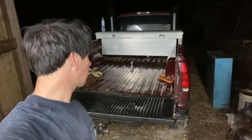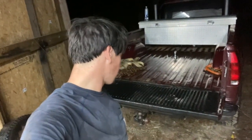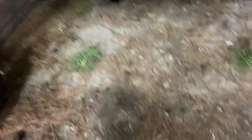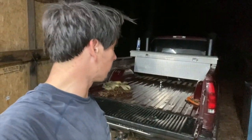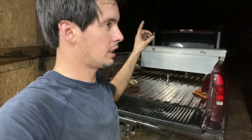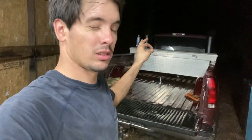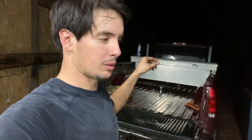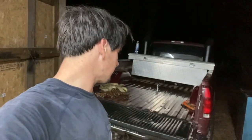That's finally all the parts we had for this truck — finally got it all finished up. I am going to take it to a local hitch shop and have them wire a brake controller and a new plug, since the one I've got is not doing so well. That's gonna be it for this truck for now, unless something goes wrong. Actually, false — I do have a boost gauge. The vacuum pump on this truck was bad, so I went to a mechanical wastegate actuator, and I ordered a new boost gauge port so I can make sure it's at the right setting for boost pressure. I will do a video on that when it gets here. Thanks for watching — please like and subscribe and we'll see you again real soon.